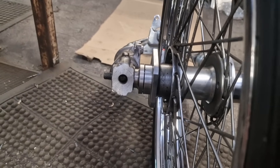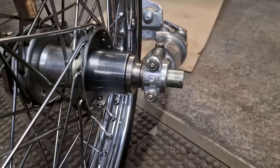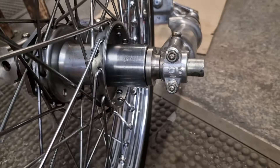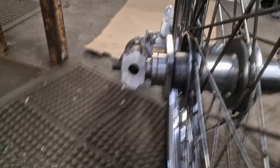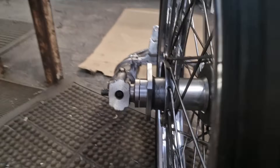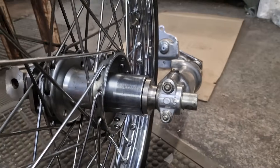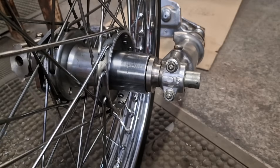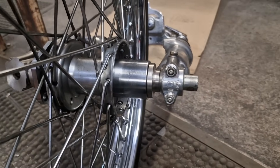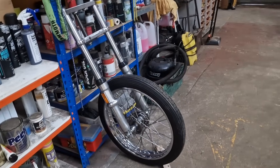Both spacers are made and they're both identical. But they're the biggest stainless I've got — my engineer hasn't got anything bigger either. Look — there's a difference: this one is fatter. I might have to remake that one, get some fatter material, just so it's smooth and parallel. No doubt this bigger diameter section is to go over the disc. Another schoolboy error — one of them days. I might go on the hunt for some 58 or 60mm stainless and make another one that's actually parallel.